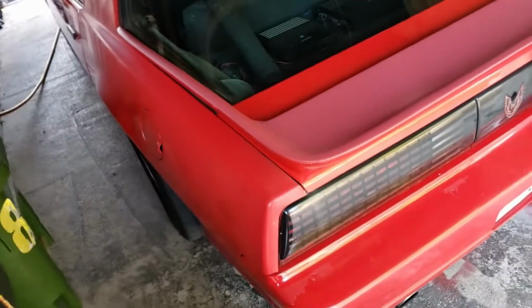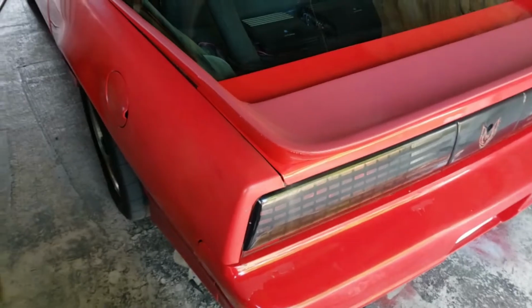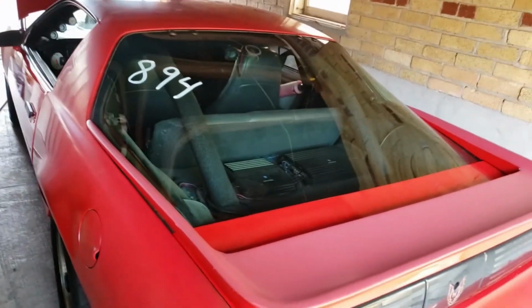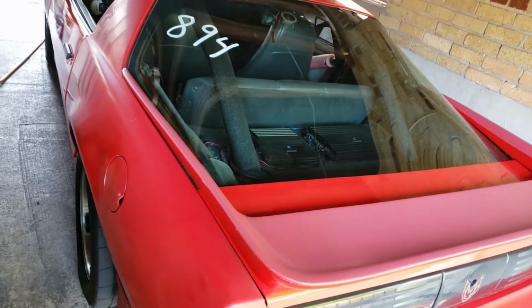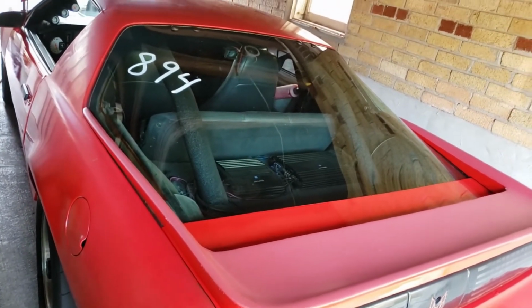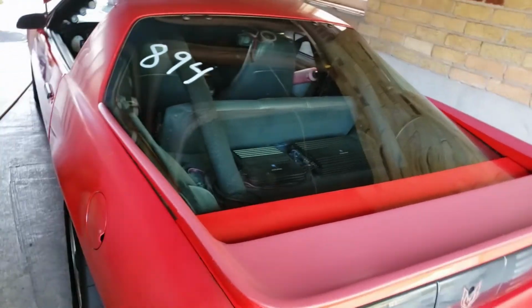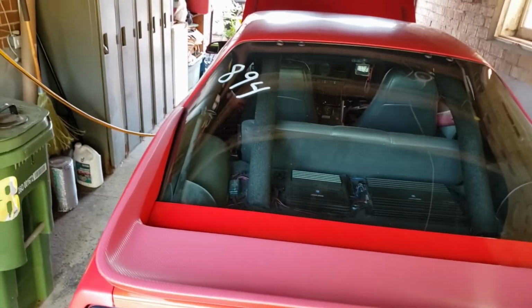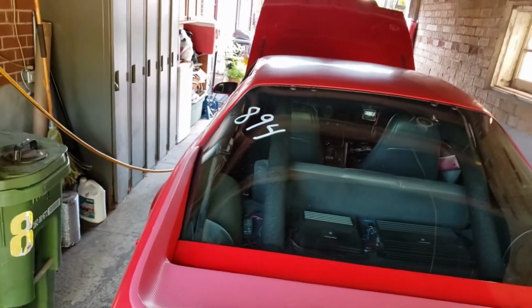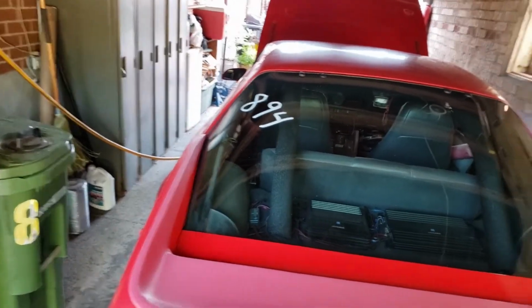And my mile per hour is down. That's the huge thing. This car before was trapping 135s to 137 prior to the motor, the bottom end letting go. So I know I have a top end issue, and the major thing that I changed this time was the lifters to the 210Rs, which do require a longer push rod, but I still think what I have in there is too short. It just nosedives on the top end. You just hear it sounds like valve float. So it just hits about 62, 63, past that, it just does nothing, and boost comes down.